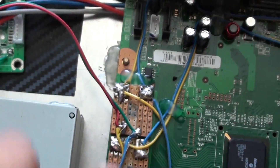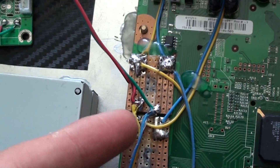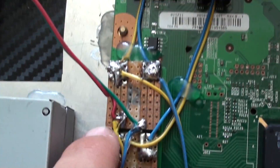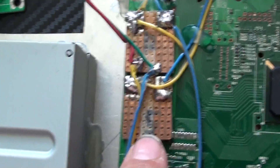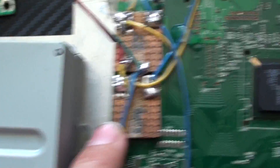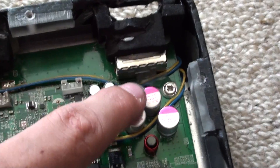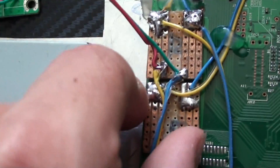The second thing I've done is put these power supply modules — I don't know what you want to call them. This one's 12 volts and this one's 5 volts for my fans. I just soldered them to the underside of the power header. You can look up the pin outs for that — it's not too hard really.